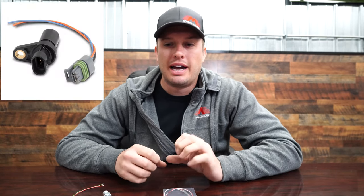So on that particular car we moved the crank sensor out front and got one of these big Holley black plastic sensors, as you can see in this picture. This thing gives you a false sense of confidence because it's huge and you think it's perfectly centered — but if it's offset inside, it could be offset by a mile. We ended up spacing it out and offsetting it, which seemed totally illogical, but it made the car run perfectly and we never had another issue with losing crank signal. It shows how all these sensors, with that small strip, leave a lot of room for error, and if they get potted slightly off, just offsetting puts it back into alignment.